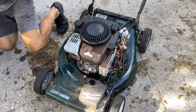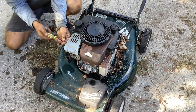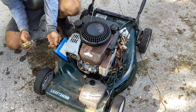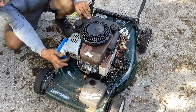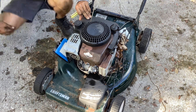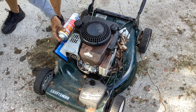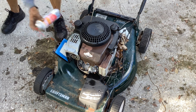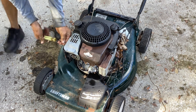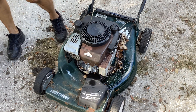Let's start over with priming. I may have to double up that gasket — the gasket between the backing plate and the carb. If there's any warpage in this plastic, it'll let air in. I'm going to give it a shot of carb cleaner to see if it'll kick off, then I'll deal with the priming bulb later. It is a new bulb, but I may need to double up on the gasket.